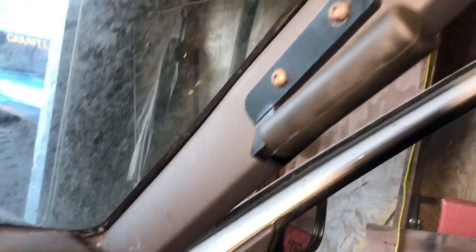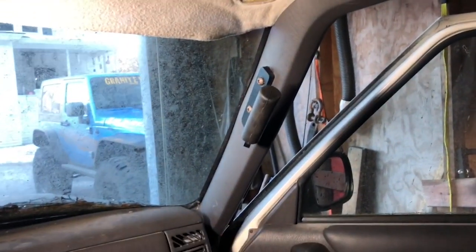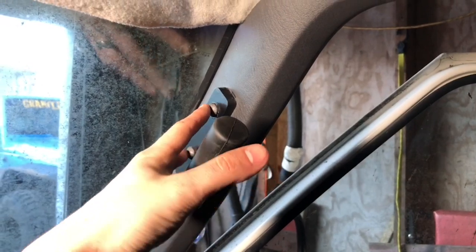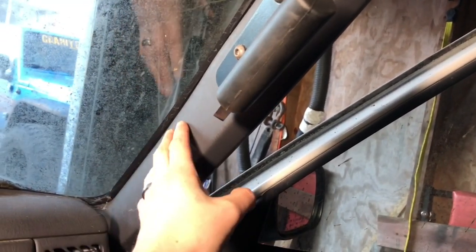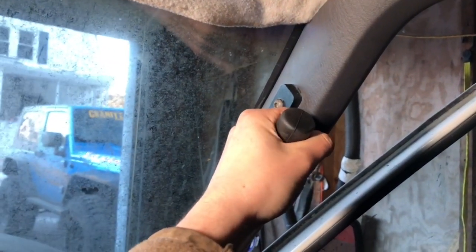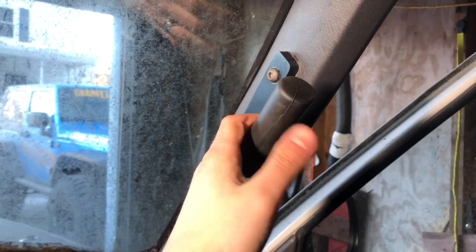It looks good on the plastic — it just sits on top and the bolts go right through the plastic into where the nutserts are mounted. Since it's a universal design you can mount it wherever you put the nutserts. You just need to avoid placing it where the push-pin clips hold the plastic panel on. I think the spot I chose is the best personally — it lined up really well with the square holes and it's nice and strong. I can shake the whole Jeep by it, so I think it's going to hold up well.